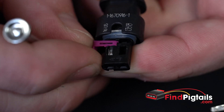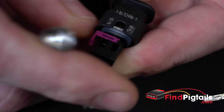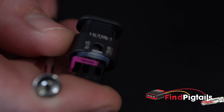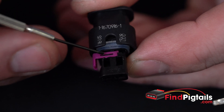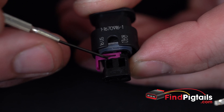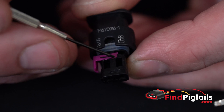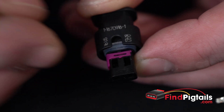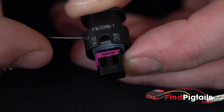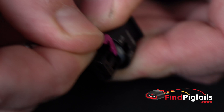Sometimes you can manipulate it a little bit more — make sure the guide is in the right position, and then you can pull it out. What I noticed was the secondary catch was pulled back a little too far. There are two little notches: the secondary position and the all-the-way-in lock position. If you're having trouble getting the pins out, check your guide — I had gone too far past the secondary notch. It's de-pinned now.